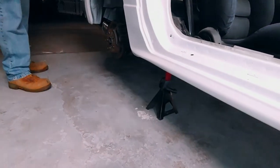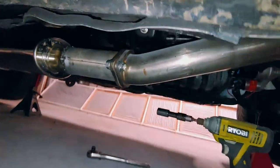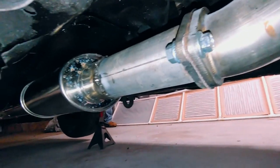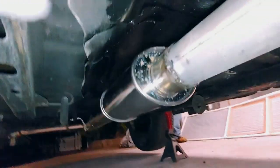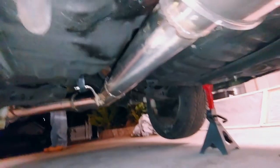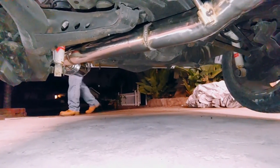We've got some nice Vibrant parts in there. If we were to price it out it would be somewhere in the $400 range. We bought this kit with the pipe for a couple hundred bucks and we have enough pipe left to almost make another exhaust or repair one. Ready to bolt it up and see how our first exhaust sounds. The down pipe comes down here, bolted up to a 2-bolt flange, Jeff welded this all together. Goes down here, looks great, uses a stock hanger location, nice and tight but with clearance — nothing touches. The suspension is as far down as it will ever travel, and it goes all the way back to our beautiful Vibrant muffler. Now we're going to fire it up and see how she sounds.